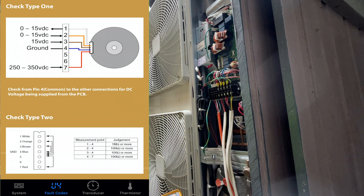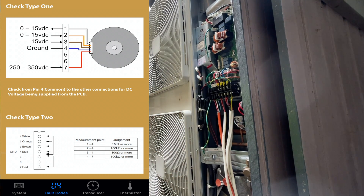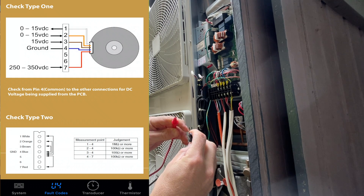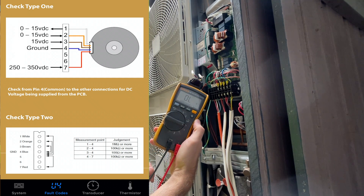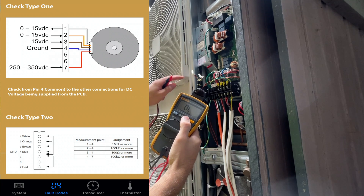The compressor did start, so I've got my multimeter and I'm going to check the resistance of each fan individually. It's important to have sharp little prongs, and your multimeter needs to be on ohms — you also need to be able to change the range because each motor is different.